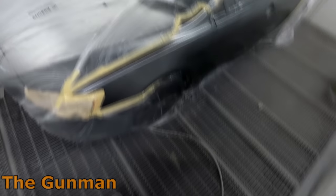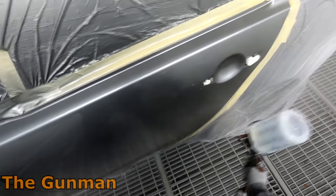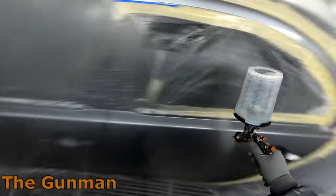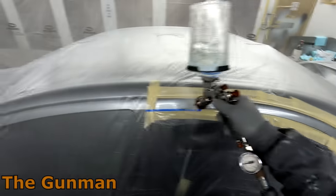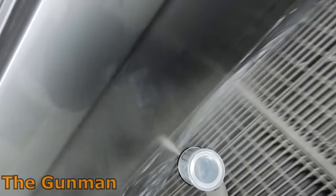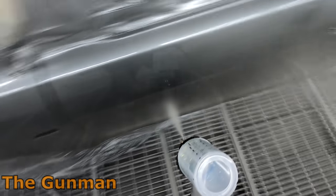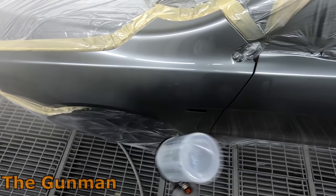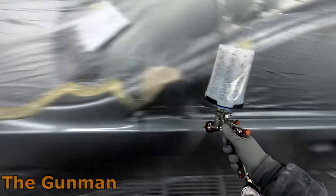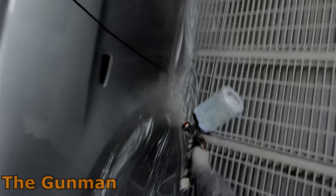I did a bit of edge masking and prep on the Lancer, got the color sorted, and just kept going. Using Standox Blue — the base coat system we use at the moment — it really is quite a fast application. I've recently learned a few things about this system that have really unlocked its full potential. Having an air screw compressor is absolutely necessary with this system. If you don't have an air screw compressor you're going to set yourself up for failure — extended wait times and drying times. I used to work in a shop with an old piston-style compressor and they really can't keep up with the high pressure air blowers needed to dry this base coat.